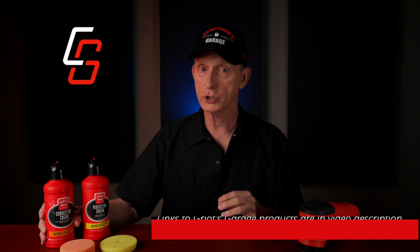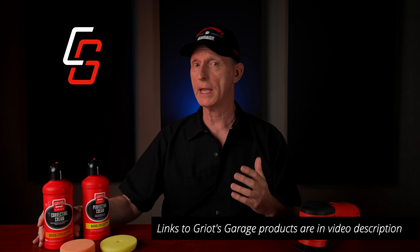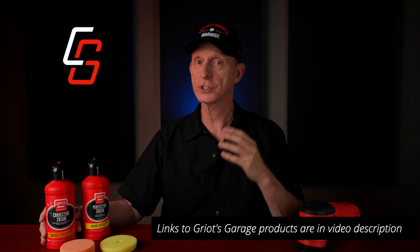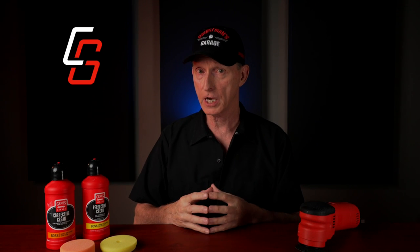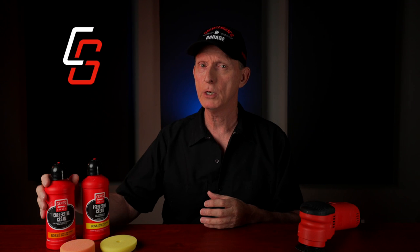compounds on the market. Today, I'm going to be using the correcting cream from Griot's Garage, which is their medium-duty compound used for paint correction. Now, Griot's also makes a fast correcting cream, which has an even heavier abrasive content, and it can cut faster or correct deeper scratches. But unless you have some really bad stuff in your paint, correcting cream should be all